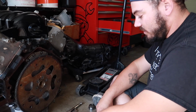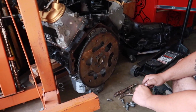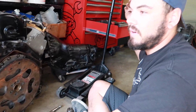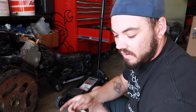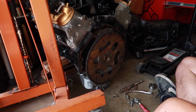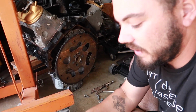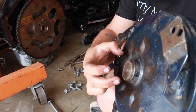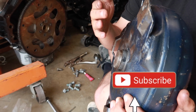Okay, that's right. And our buddy Steph let us borrow that 6.0, and we thought with this torque converter and the spacer that comes on that we would have clearance, but it wasn't deep enough. Our torque converter outer ring was only seated like halfway.